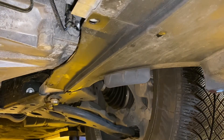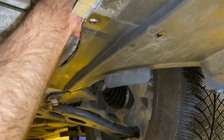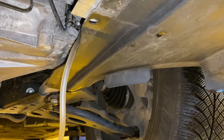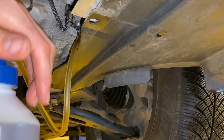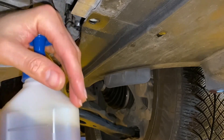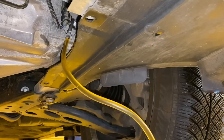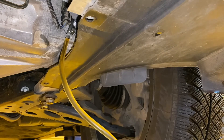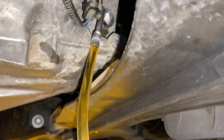Now I'm putting the hose for the new fluid into the fill plug and using a manual pump — yes, manual, so I'm pumping away. Fortunately it wasn't too strenuous. For the F60 series Countryman it takes two quarts of manual transmission fluid. When filling any manual transmission, there's no gauge — you just fill it until fluid starts dripping out of the fill hole. Once it drips out, you're good to go.